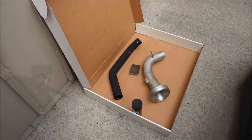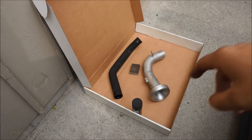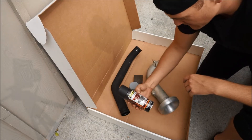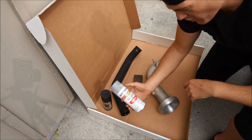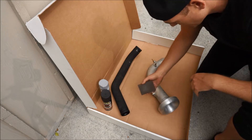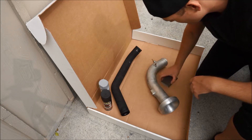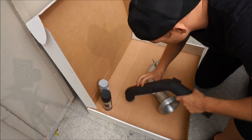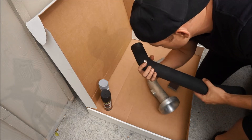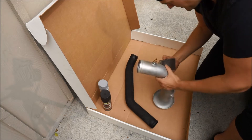I've got a big cardboard box so I don't get any overspray. We're gonna use a VHT sanding block — 800 grit — and I'm actually going to primer this first using automotive primer. The first thing I like to do before taping anything off is just sand everything so we get a really nice adhesive surface. You can see underneath where it's shiny and polished — that's probably why the old paint didn't stick. Let's start sanding.